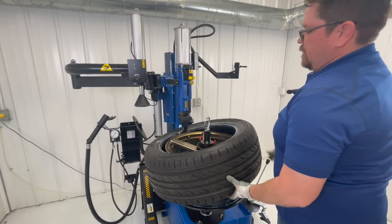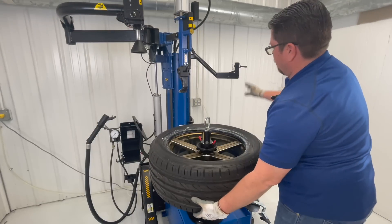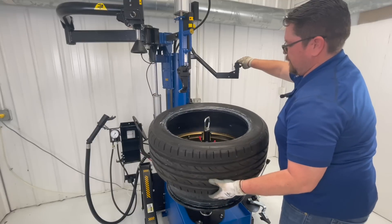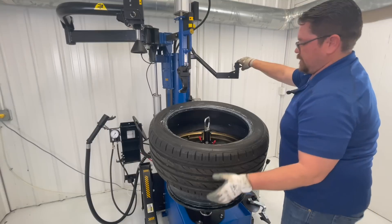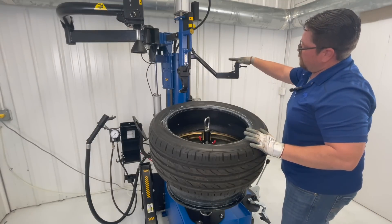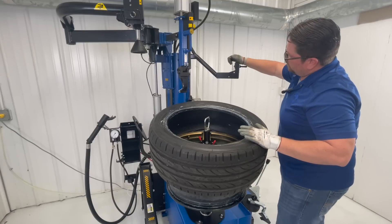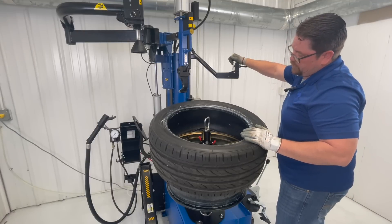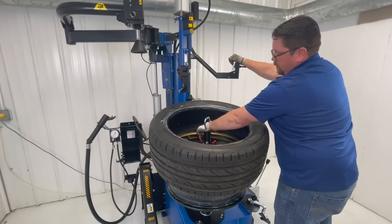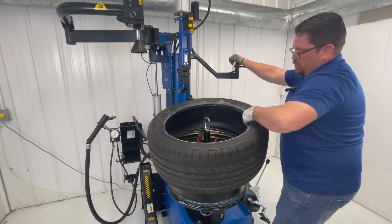We're going to remove our tire tool. Then the bottom bead gets removed with the roller. As you can see, the roller is peeking out through there — that's what you want to see. Right here on the same controls where you have this roller, there's a small lever in the back. If you pull it towards you, the roller comes in between the bead of the tire and the wheel, and that would allow you to have your wheel removed.